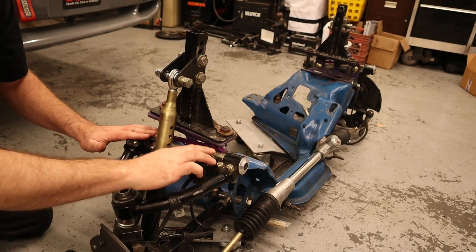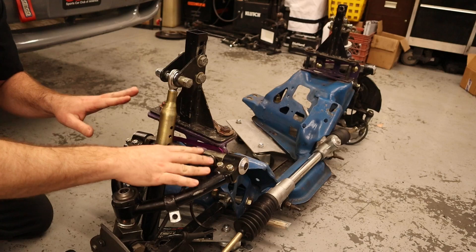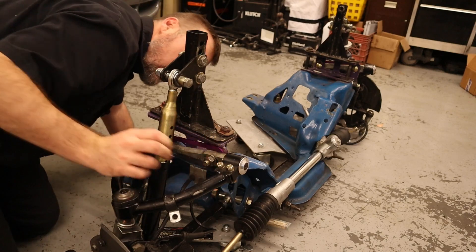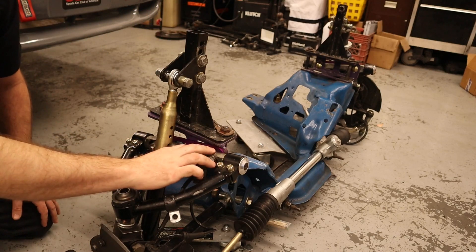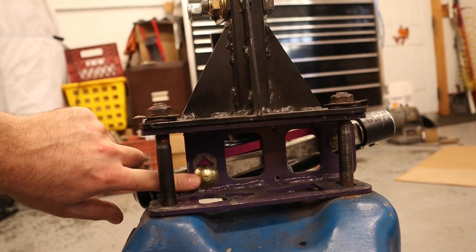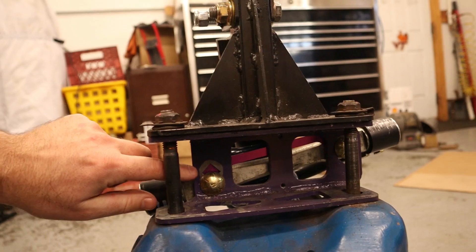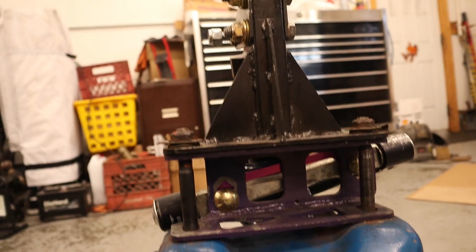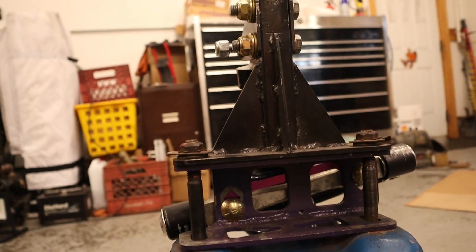You'll also notice there is some angle done up in here. There are two holes that I can change the angle of this arm to get more anti-dive if I want it. Right now it's on the bottom hole in the back and the top hole on the front — the most aggressive anti-dive setting. You can see those are square holes and these are button head carriage bolts. I did that so these can get as close to the frame as possible, and since they're square holes, the bolt can't rotate, allowing me to tighten up the upper control arms properly.